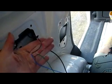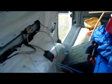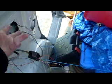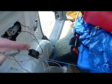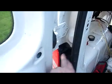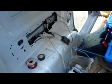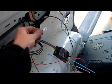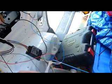There it is connecting my fog and my indicator. Some fogs have two wires so you have to cut the fog wire in half and put one wire to the car and one to the relay — this one is just a straight connection, so you might need three-core cable. I ran it over through the ceiling to hide it. There's no real need to remove the tail lamps — I removed mine because I had no reference video to go on, which is why it took me longer than it should.